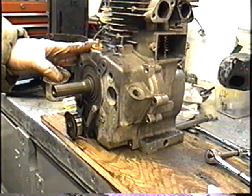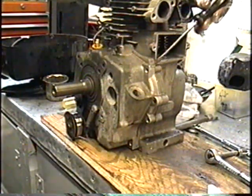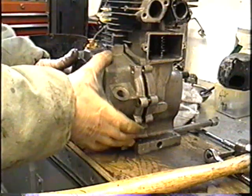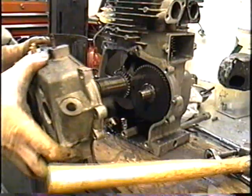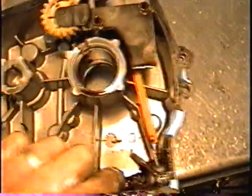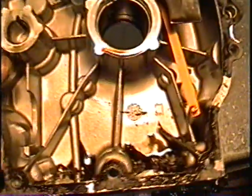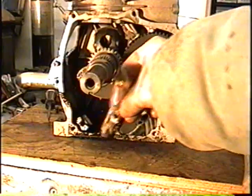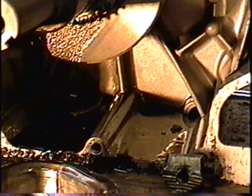It's time to remove the sump cover. I've got all the bolts off — they're all 3/8 heads — so I'm just going to gently tap it open. Seems to be coming off pretty easy, very easy today actually. There's the inside of the sump — you can see all the metal shavings at the bottom here, probably pieces of the connecting rod. Everything else looks good. I'm going to peek inside the engine now — there's pieces of the connecting rod and a bit of shavings in the bottom there too.